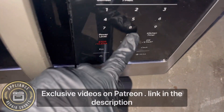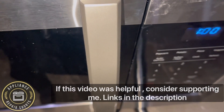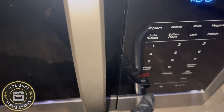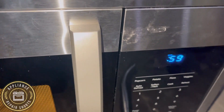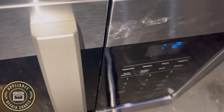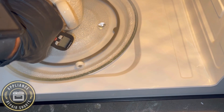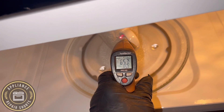Let's do a minute. Now pay attention to the noise or the sound that it's making — it's got a deep heavy hum. Usually, not always, but we're going to check the magnetron. That's part of the heating circuit. So 65 degrees — same thing, nothing has changed.